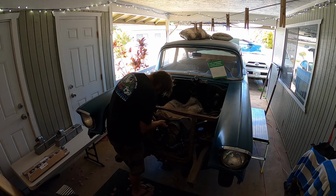And one of the things was on some of the VIN number K, L31 center bolt valve cover standard ones, the intake manifold gaskets leaked a lot and leaked internally, and they would just get antifreeze in and destroy the motor. So the trick was to just change the intake manifold, or if the motor was junk, you put a new GM Performance crate motor in, and the warranty would be void if you did not use GM Performance's black or gray or whatever RTV that they had, or the Right Stuff.